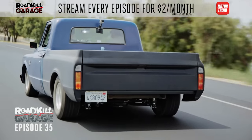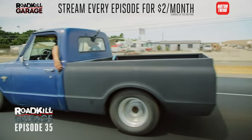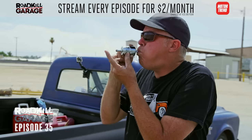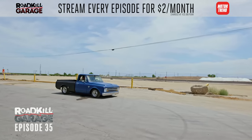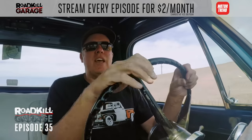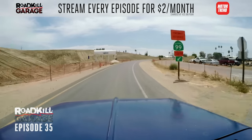Cruising the freeway and everything's going great, then we watch the fuel pressure start to drop. I'm reaching out the window trying to vent the cap, and we're pretty sure the fuel filter is getting clogged. We pulled over to change it without getting gas all over ourselves — it was hardly dripping, definitely clogged. Odds it'll go more than 20 miles? Greater than 50%. Fuel pressure is still picking up crud from the tank, which means we're passing that crud through the fuel pump too.